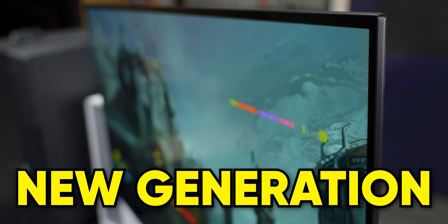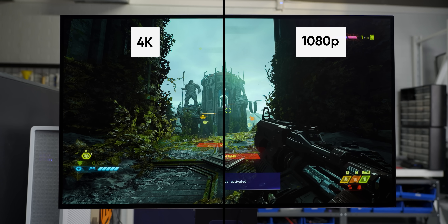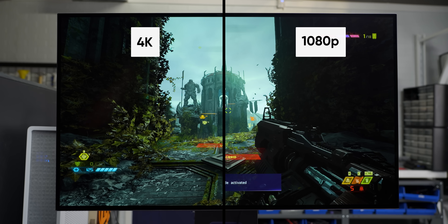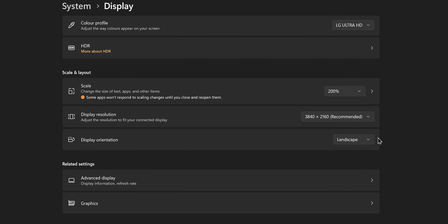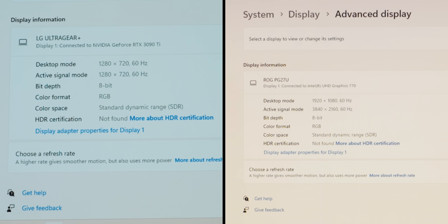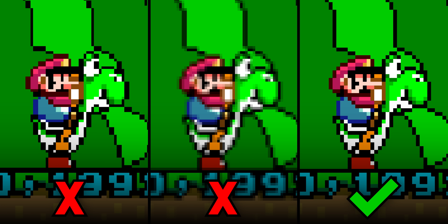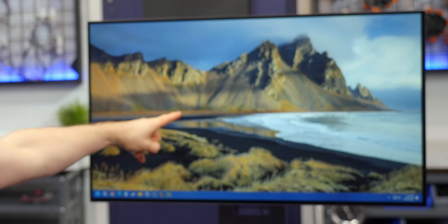This is part of a new generation of OLED displays that LG is calling dual mode. It allows you to switch between the native 4K resolution and 1080p resolution. You might be thinking you can do that on your monitor right now — is your monitor dual mode? Yes, but also no. If you have a modern display it may be capable of interpreting a signal in all of those different modes, but only one of them is native — able to be displayed cleanly without any scaling.